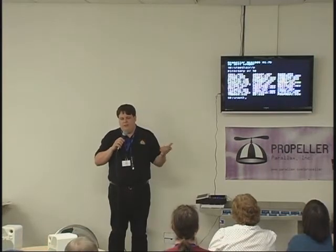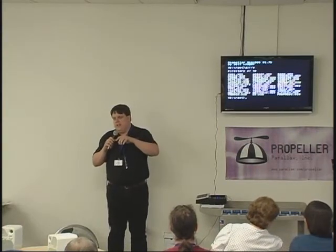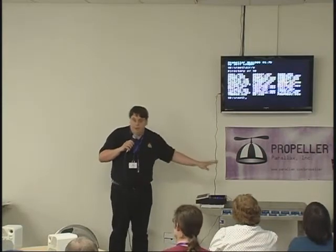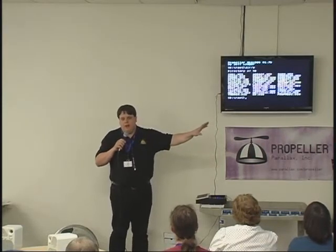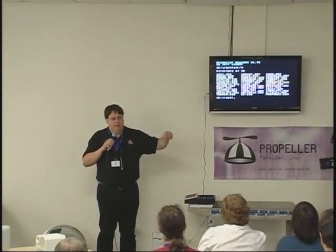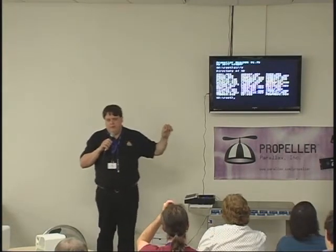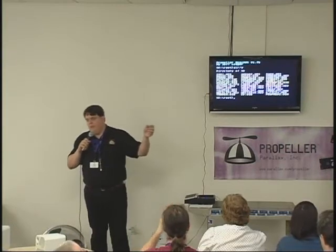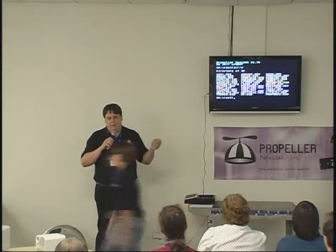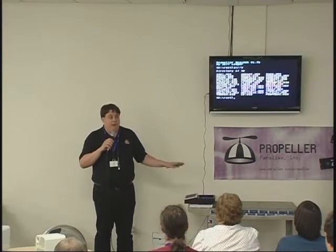You can buy these things all over the internet for about $30. What they're designed to do is you run a program on your PC, stream your MP3 files into it, then hook up your music bridge by your stereo — it picks up that signal and has RCA plugs on the outputs to plug into your stereo so you can listen to music somewhere else in the house. But what I've discovered is that you can run it backwards: it will act as an ethernet bridge. Most ethernet bridges are about a hundred bucks, so this does the exact same job for about $30.